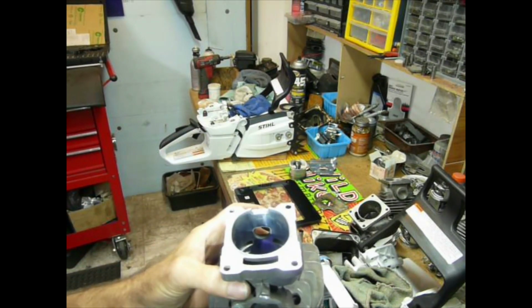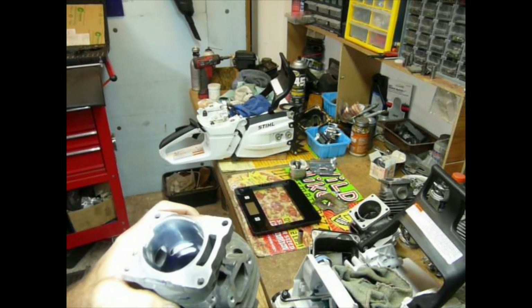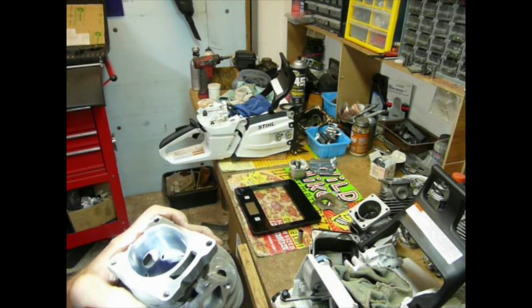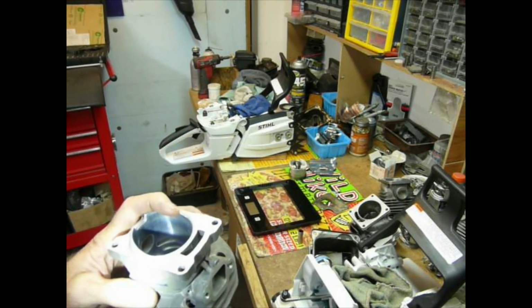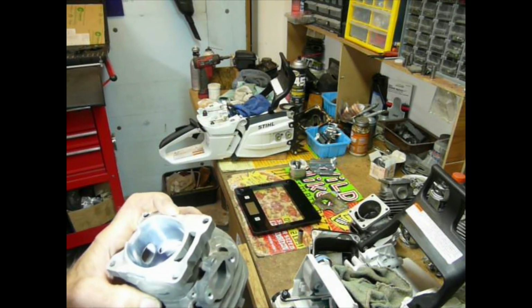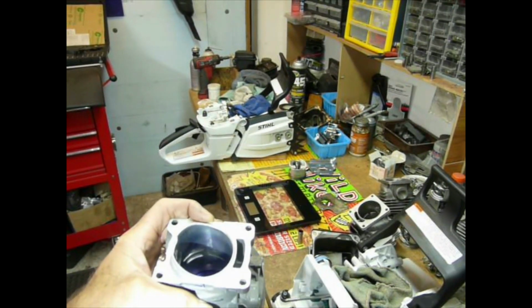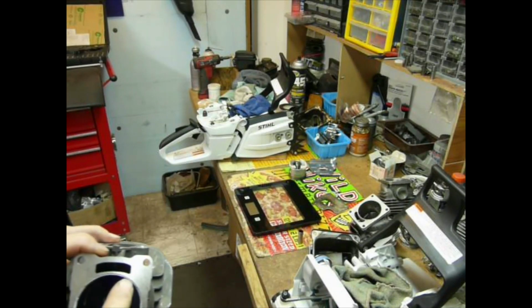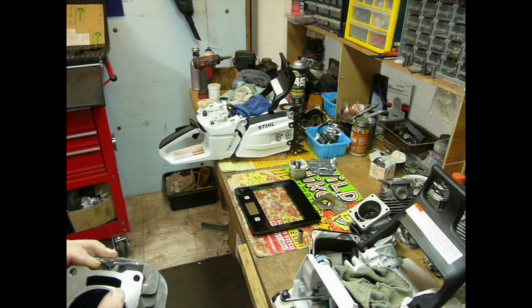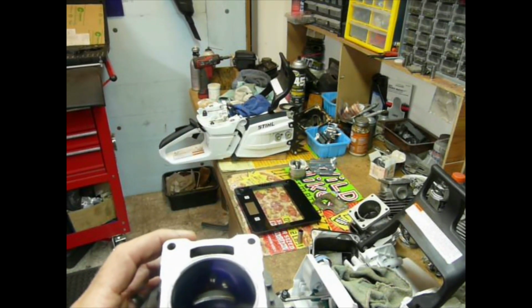Again, we look at the circuit coming in there, we can see it's still kind of rounded, which is actually nice. If we look down in there, we can see it's a quad loop kind of system, real wide. We can see how wide that stratification port is. It's the one that's closest to my finger, the one that's lower in the cylinder. And kind of rounded, not so squarish transfer ports like we see in the 461, which is kind of nice. If we look at the start of the transfer port circuit in the cylinder, we can see it's consistent. The shape is nice. It's kind of small, but if we look down in there, we can see the exhaust port's actually really wide, which is really nice.